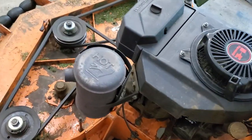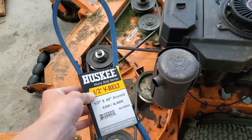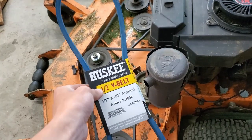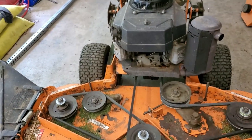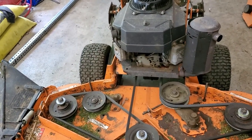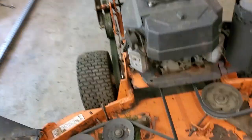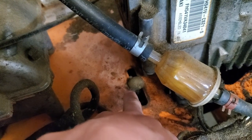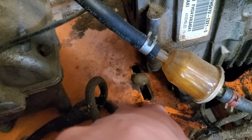The next thing I want to do with this mower is replace the transmission drive belt, which I bought at Tractor Supply. It's the only belt I didn't change when I got the mower. The previous owner said he changed it, but I don't think he did because it seems like it's slipping a lot. There's an idler pulley to keep tension on the belt, so I have to go under there, loosen that, and slide it over so it has no tension, and then take it off.